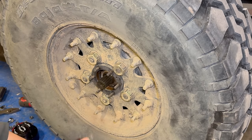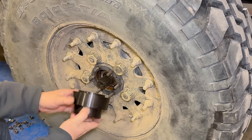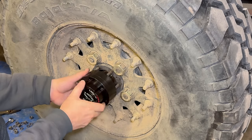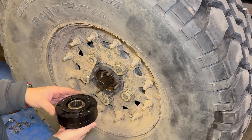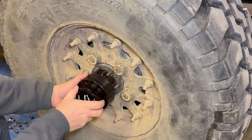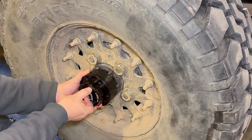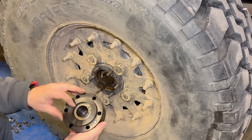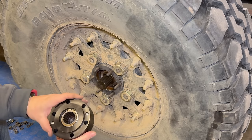There we go — this is off. If I hold this up you can see how it's going to work. The spline on the axle goes into here, and if I put this on lined up with the axle I can spin this freely — that means if the axle was turning, the wheels would not be turned by it. Now if I set it to the lock position, I can't turn it any longer because it's now locked to this piece, so the axle will be locked to the wheel and those two are going to have to turn at the same time.